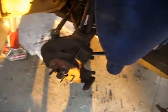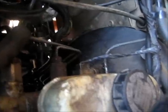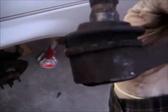I just finished connecting everything up front, so I just need to do brakes — obviously tighten up that nut there, jack up the rear and get the brake hose going, and get a master cylinder due to the fact that the master cylinder is cracking pretty badly right now. I've got to break these lines loose and get that out. This is the passenger side lower control arm — the ball joint is actually okay, still requires quite a bit of effort to move it, so it was doing fine. Ford made it ungreaseable, of course. The bushing in the middle was fine; it was just the bushing in the back that was completely done. Anyway, I'm cleaning up and then I'm going to head home.